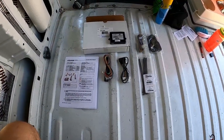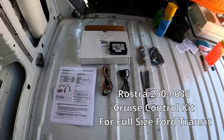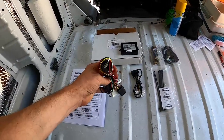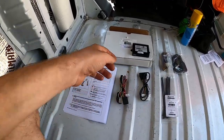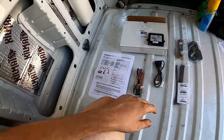Here's the kit I got — it's a Rostra Precision Controls kit. When I bought it on Amazon it was about $300. You can see the part number here. The kit comes with instructions, some connections — this one connects to the gas pedal connection. It's fly-by-wire, so there's no actual gas pedal wire controlling a carburetor. It's an electrical signal that goes from the gas pedal to the engine telling it how fast to go. You tap into that so it just plugs into the unit.